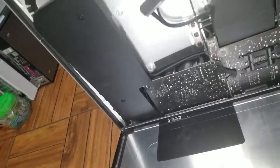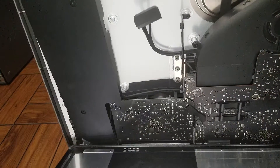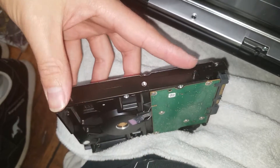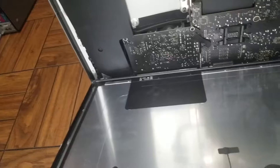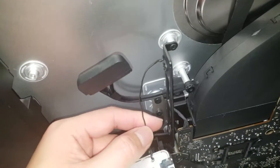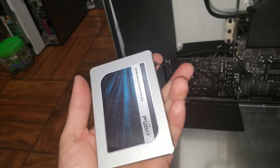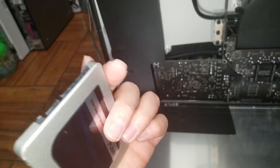You can replace this with an SSD. Since SSDs are smaller, you'll need a bracket — a 2.5-inch to 3.5-inch drive adapter, available online or in stores. Make sure it's designed for this, because Apple specifically uses only the outer screw holes, so the adapter needs holes on those sides. Alternatively, if you don't have an adapter, you can thread a twist tie through the SSD and hang it in the middle of the bay. It's good for vibration, though SSDs don't have that issue anyway. It's a bit more work, but it gets the job done without needing the caddy.